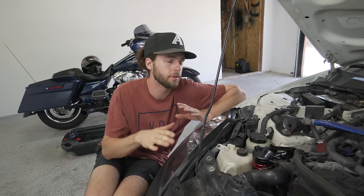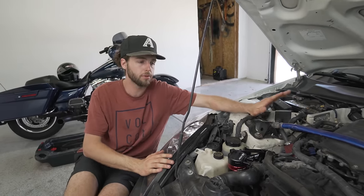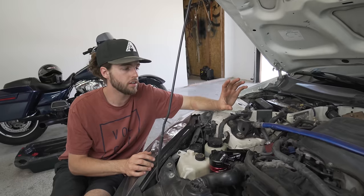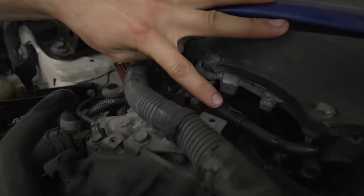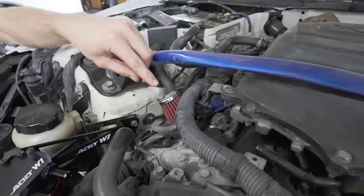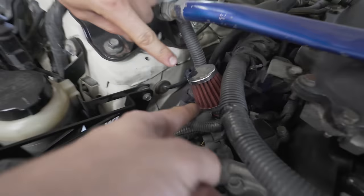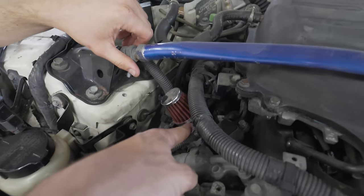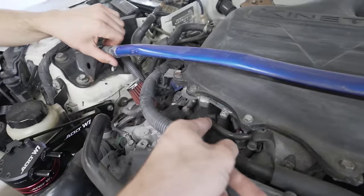Serious talk — I'm going to make another video about this because everyone needs to know. I talked to Good Speed Performance, John, who's done a lot of 350Z work, to get the facts straight about PCV, catch cans, venting to atmosphere, and things like that. So the previous owner did a delete: normally there's a tube here that pulls air into the engine on the positive vacuum side and runs to this filter. A super popular mod on 350Zs to help them from burning oil is to delete that tube, vent the negative pressure out, and plug where positive pressure usually returns to the crank.